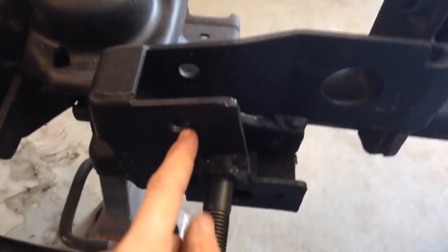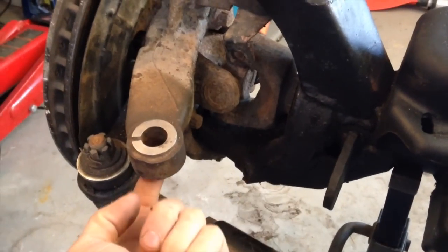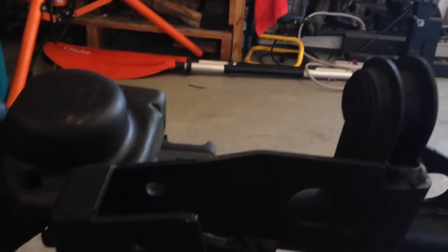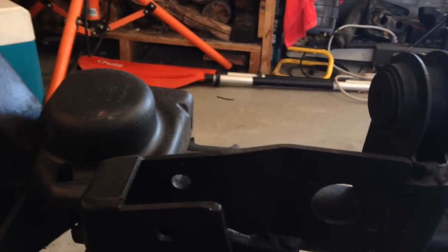This one also has flip steering. When you raise your track bar mount, you should also do a flip steering. Normally your drag link comes here and goes to the bottom, but instead now it'll go to the top. The more parallel to the ground your track bar and drag link are, the nicer your Jeep's going to drive — that's optimally what you want.